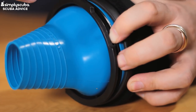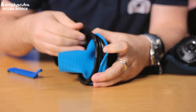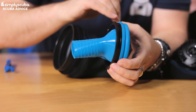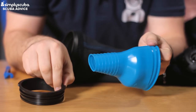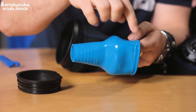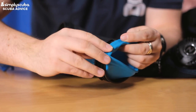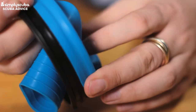There are ridges on the ring that you can get a bit of grip on. Get the tool underneath the ridges and lever the ring out — it just pulls out. Once it's out, the silicone cuff seal is wrapped over the back side of the ring itself, so just take that off and replace it with a brand new one. On the outside of the replacement cuff seal there's a little lip at the back end — that's going to sit inside the ring. Put it all the way through with the shiny side outside, fold it over until it's on that second lip, and push it all the way around so it's fitted nice and neatly.